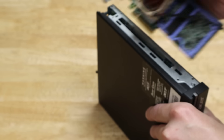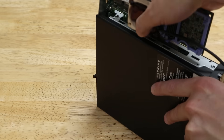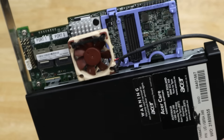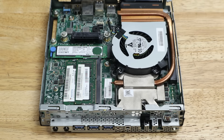This is especially interesting, because if you want an affordable mini PC with a PCIe slot, you'd be looking at the handful of Lenovo models that include one internally, like the M910X and the M720Q. They're not bad, however they are rather limited, with significant size and thermal constraints. You miss out on the SATA connector for extra storage, and the cards you can install are limited by the size of the case, as major components like the CPU cooler get in the way of installing a full-height card.